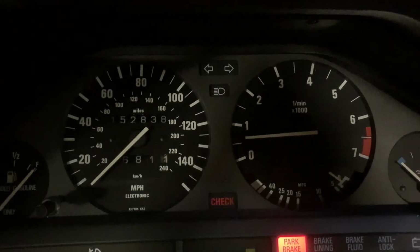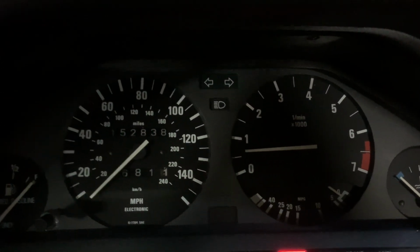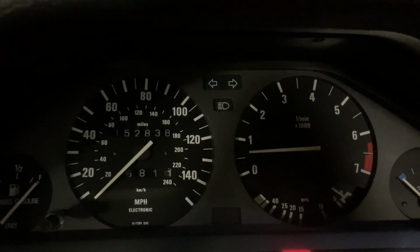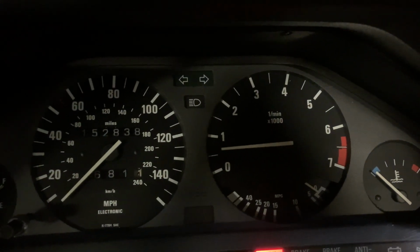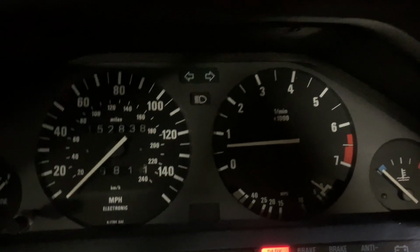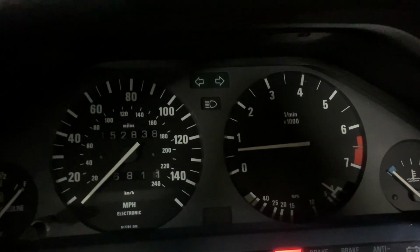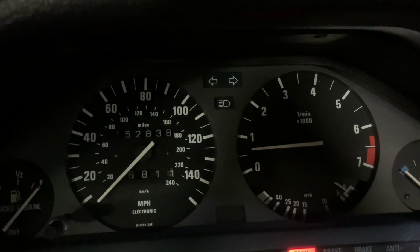And this is fine. This is kind of what you want, about 500 or so, 600 RPM. 600,000? 600. You don't have a rocket. Yeah, that's right. Well, it's times 1,000, so it's at 0.6. So yeah, 600. Can't believe I can't get that right. So it's idling just fine now.